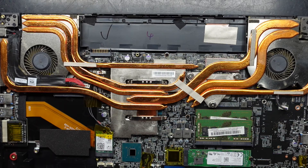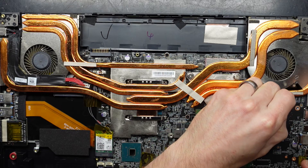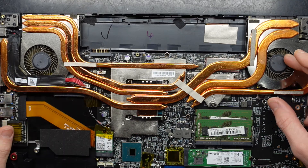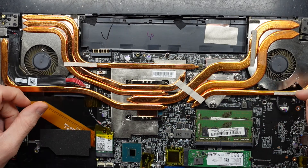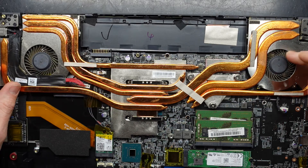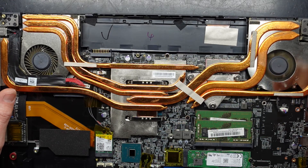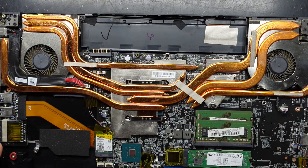Another easy way — I've just found out what fan it was, but I should have done this first and didn't have to disconnect the fan. A simple fan flick while it's off: the CPU fan is over here, the GPU fan is here. This one does not want to spin — this one is quite happy to spin. This one is stopping as soon as there's no force on it. So one unhappy fan over here — the GPU fan has failed.